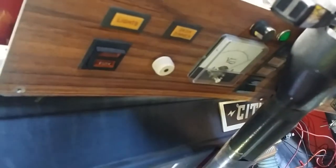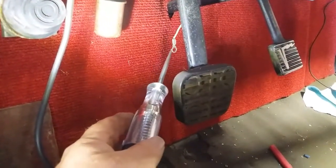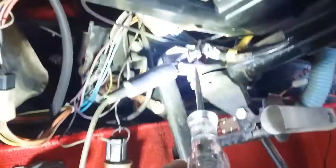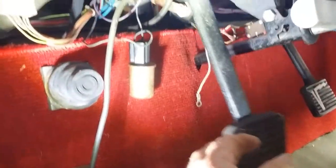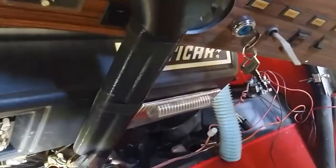Also the horn, which did start to work. So we have a horn bigger than the car. One thing I noticed was a wire hanging down that was hot with the key on, and somebody has removed it from the brake light switch. The brake pedal is not returning — that should fix itself when we get the master cylinder replaced. The master cylinder is just a total rust bucket. I haven't fixed the little dome light thing yet either.